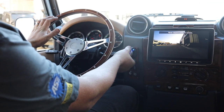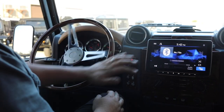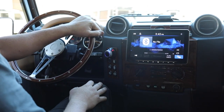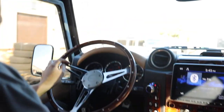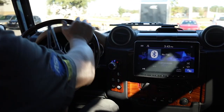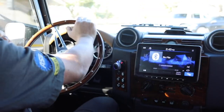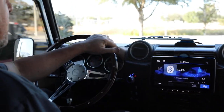We're going to choose drive and pull away. That's it. The transmission doesn't actually shift. The motors always engage with gears — the motor just switches directions, so it's like a big radio control car. You just choose what direction and how fast the motor spins, and your throttle is like squeezing a trigger on a radio control car controller.